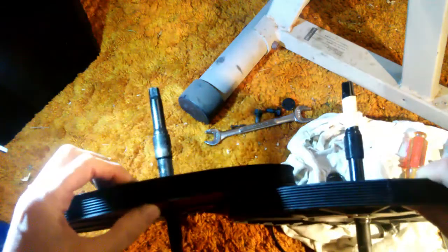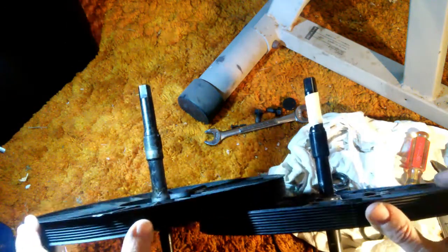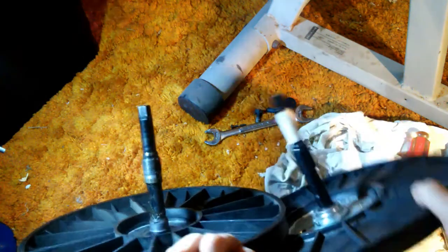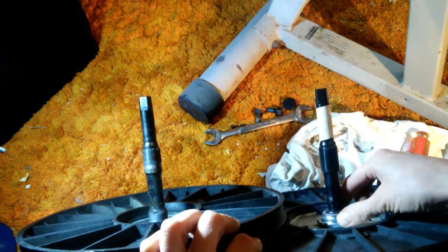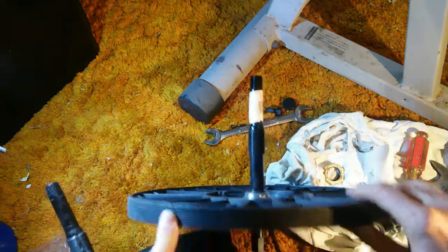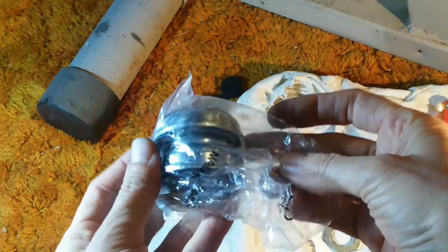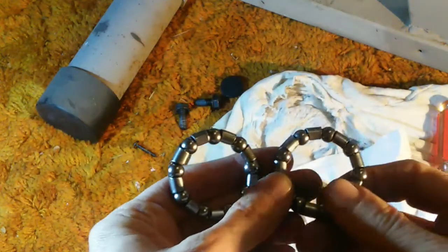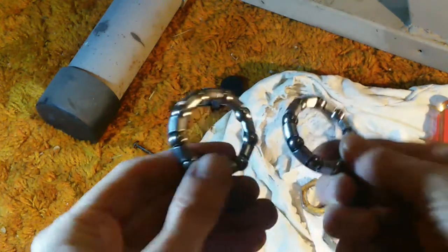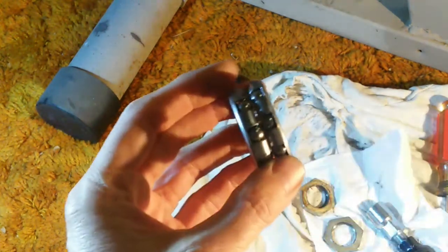But I was surprised — I was able to get another one. I purchased this replacement pulley-axle combination on Amazon, and the part number will be in the description. All the threads are perfect, and it even comes with an inner bearing race already in place. This only cost me $39, which was amazing. I was also able to buy a complete bearing set, which comes with two sets of caged ball bearings, inner and outer races — everything you need. If your axle and bearing races are in good shape, you can buy just the ball bearings for less.